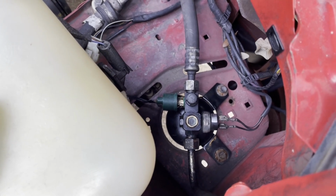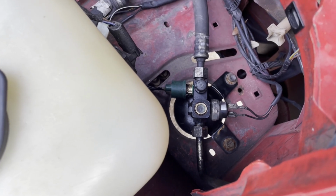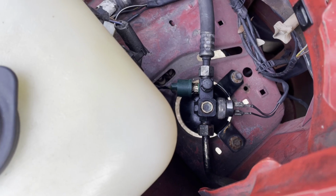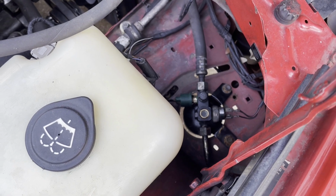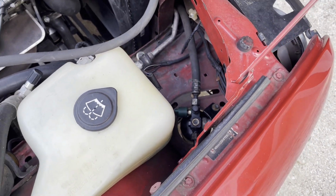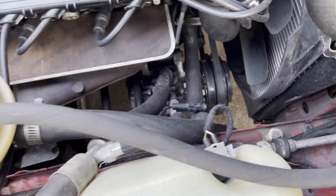You can see that green sensor on the left. You can also see the nut is a little bit gummed up. That's because I had to put pliers on it to try to tighten it just a little bit more, because I had my little sniffer thing and it seemed like that was leaking, and that's where it came out from, because the AC just slowly went away and quit working. So we know the compressor down there and all that stuff works.